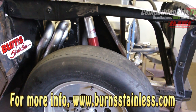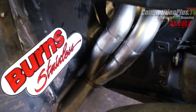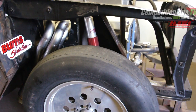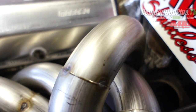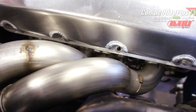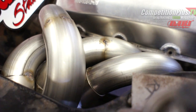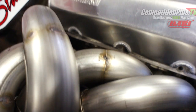Going over clearance on the front end — as per NHRA rules, they want the correct wheelbase plus or minus three-quarters of an inch, so you can't shove the front end way forward to get more tire clearance. We started with the hardest side, pipe number two, which was the closest to the inner fender well shock tower. That was the most difficult one to make — no easy task getting around that close shock tower and up around into the fender well.